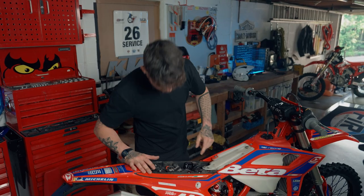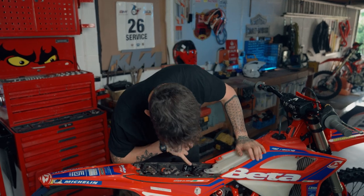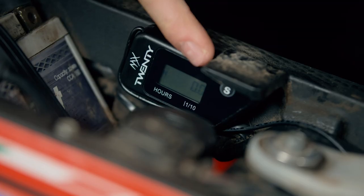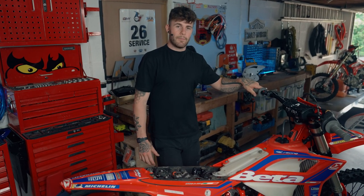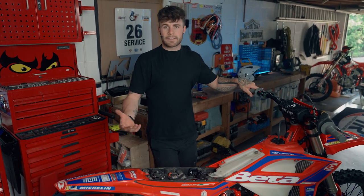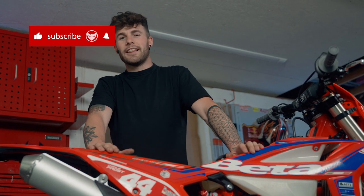By a simple click of this button down here, without the engine running, you'll see that it will say 0.0, so we know it's connected properly. When the engine is running it will also pick up the RPM so you can see the revs, and the hour meter will count up. So for any maintenance work, I highly recommend one of these hour meters. That was a video tutorial on how to fit an hour meter onto a dirt bike — I hope it was informative. Don't forget to drop a comment, like, and subscribe, and I'll see you on the next video.